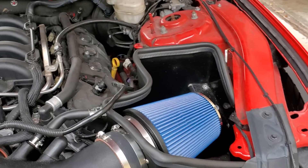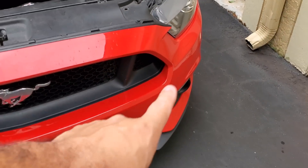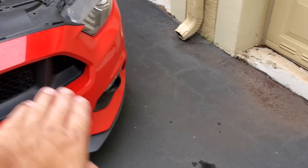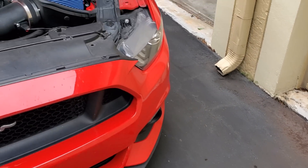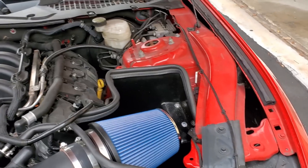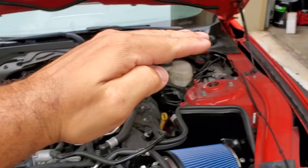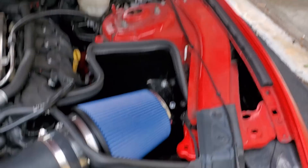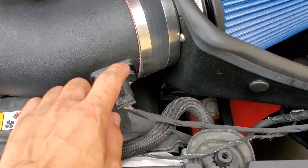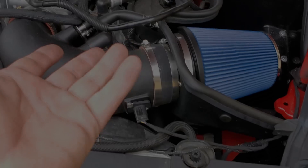Am I telling you to always get a covered cold air intake? Not necessarily — when you're roll racing in a cold environment, say 60 degrees and under, with air being shoved in nicely, an open air element is going to make more power than a closed one. But on a hot summer day at the track, creeping through the staging lanes and doing a burnout, your IATs are going to be 140 and up in 80-plus degree weather. The IAT sensor is going to pull timing based on the calibration to protect the engine.